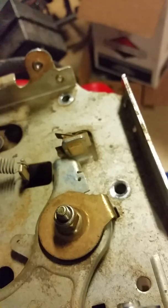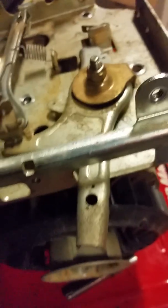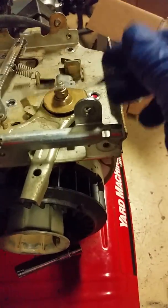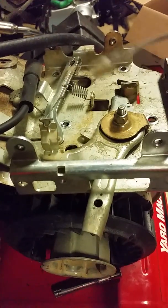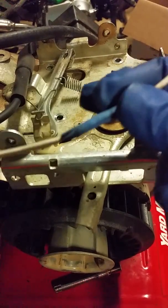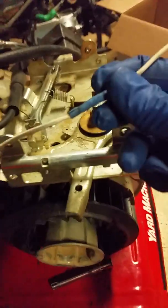There's a hole right there — bring it up through that hole, feed it through the bottom, and again into that plastic housing, put that tab back, and it should operate as it's supposed to. Someone had worked on this engine prior to me, and this wire was mashed by the housing. With all the vibration, the rubber rubbed against the metal surface and eventually wore down the sleeve, causing it to ground out.